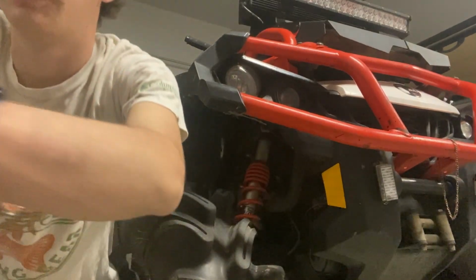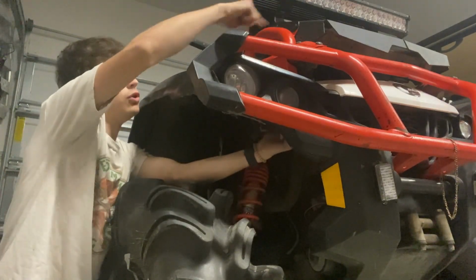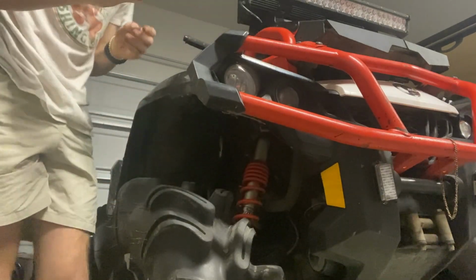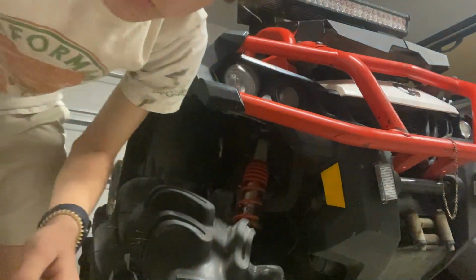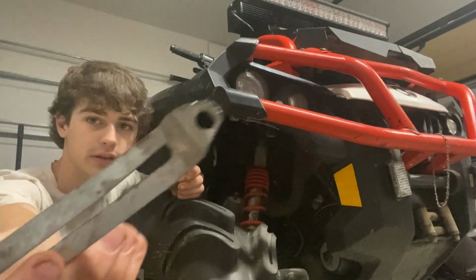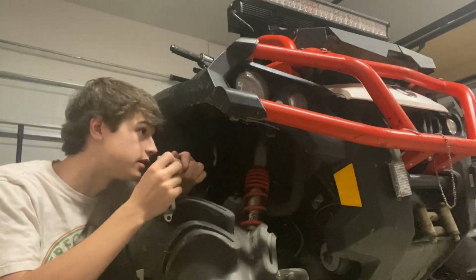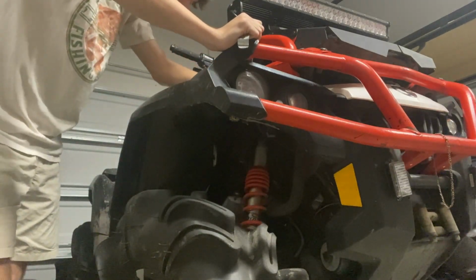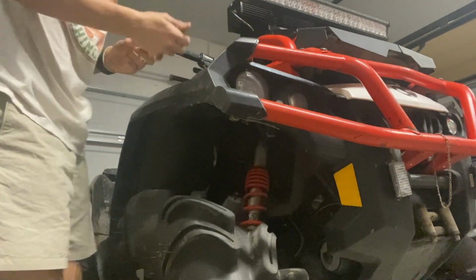So all I did there was take a bolt. It's a little bolt that holds in this front tube that comes down by your rad kit. And it's a 13 millimeter top and bottom. So you need a 13 mil socket and wrench to hold on the top, but that's off. So now I've got a freshly, kind of horribly looking, shaved mount, and then this bolt is just gonna come and sit right where it's supposed to go. Finagle it in there. There it is.